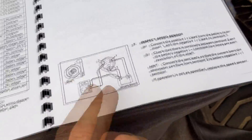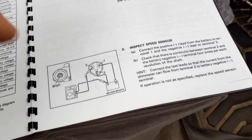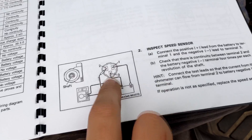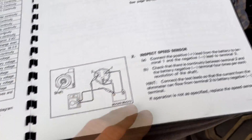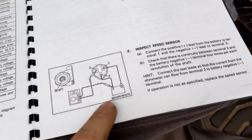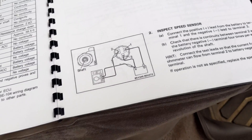The next step is to take the sensor out. What you can do is rotate it in a drill and check for four continuity spots every rotation. In the manual, they say to put battery voltage between pin 1 and 3, then rotate it and check between pin 2 and ground - you'll get 12 volts four times every revolution, because it's a four-pulse sensor. But instead of doing that, I'm just going to rotate it by hand. I should get four points of continuity. Chances are I don't have any.